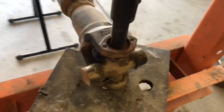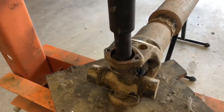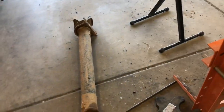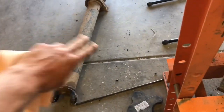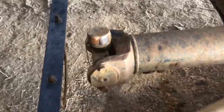This went a lot easier than I thought. Using the Harbor Freight press with a steel plate with a hole cut in the bottom — that's never happened to me before, but that's the easiest a U-joint has ever come out for me. The flange came off; that one's trash now. We'll put this U-joint in — it looks like it's got lots of life left, the grease looks clean. So I'll just reuse it, put it in here, and now we have our drive shaft.